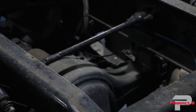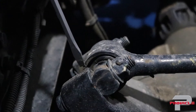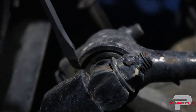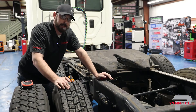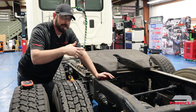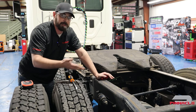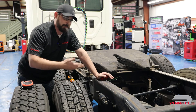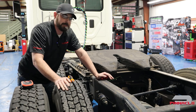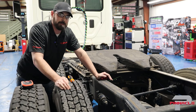We're going to have to get this dog bone replaced before we can perform a proper alignment. This is a big reason why you want to perform a thorough vehicle inspection early. As soon as the service writer hands me the paperwork, I do the inspection right away — that way I can get the part coming in without pulling the truck into the bay, starting the alignment, then realizing I need to replace the dog bone and having to pull the truck back out and wait for parts. It's much easier to knock out your inspection and test drive first, get all the parts, and then get everything squared away.